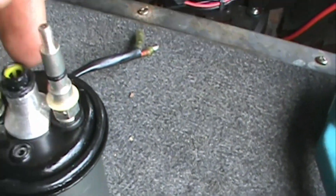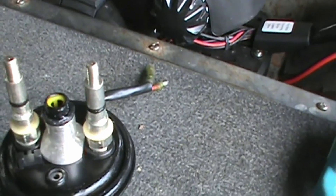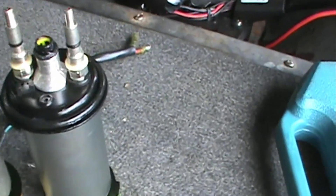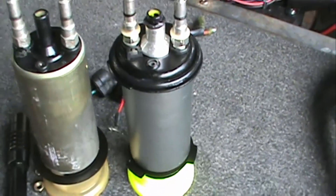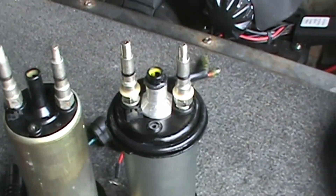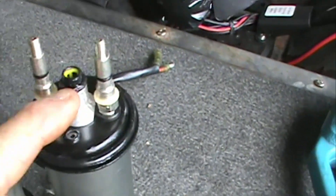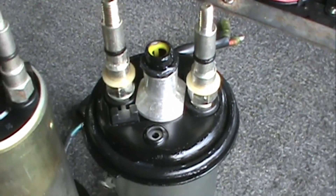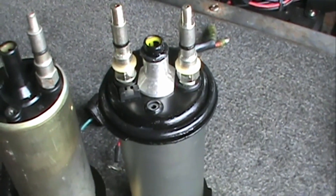Get those nylon washers out and put them on. Also your high-pressure output o-ring — a new one possibly doesn't come with the pump, so you can either get a new one or pull the old one off, check it, make sure there are no cuts in it, and install it. It does come with your filter and everything to install the filter. The bracket is already in place and you'll install the lower one above the fuel filter. Look at a parts diagram and you can see where these parts go.